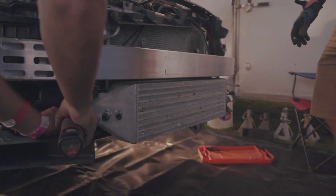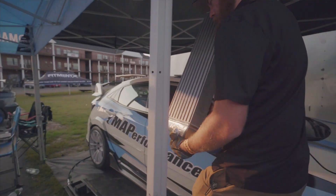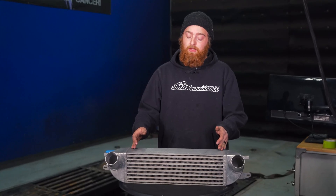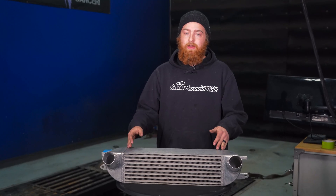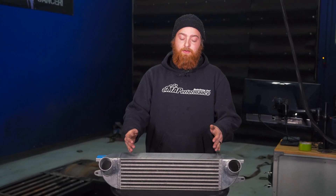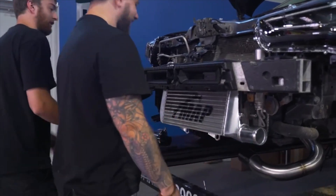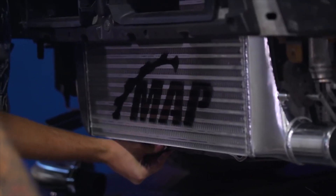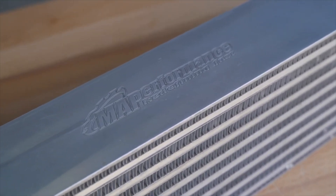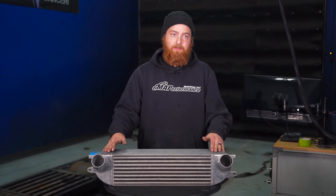When it comes to choosing your intercooler and specifically your intercooler core, there are a couple of things you're going to want to look out for — everything is based on exactly what your application is. If you buy too large of an intercooler, your time to fill is going to be really long, resulting in some kind of weird power loss in certain areas. We talk about fin density a lot. If you have too wide of a fin density, the thermal transfer of heat out of the intercooler isn't going to be very good, resulting in higher intake air temps. If you have too tight of a fin density, you'll generally see some pressure loss between your inlet and your outlet, also resulting in poor power.